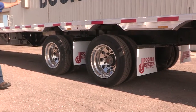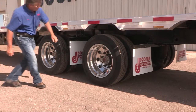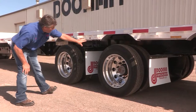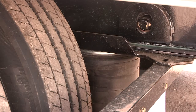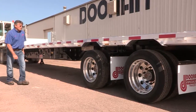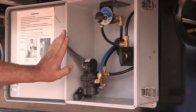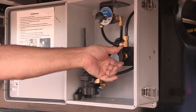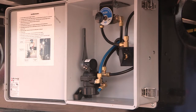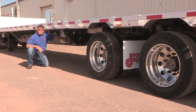You're going to get to a point where it stops. Come back out to your trailer, push your knob in, and verify the pins are located in their locking holes. Everything will be locked in. At that point, come back to your raise and lower valve box. You're going to push this up, turn that down, and pull this lever out to reset your brakes.